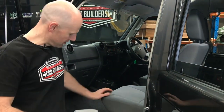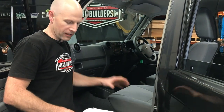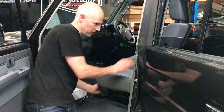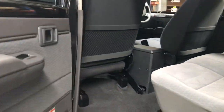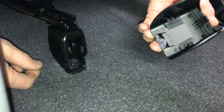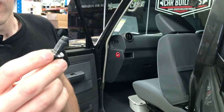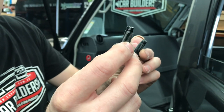First thing we're going to do is remove our seats — 14mm socket. Good thing to do: get yourself a bucket. Anything you take off, put in there so you're not going to lose parts. There are two bolts at the front and two bolts at the back. The ones at the back have a plastic cover on them — this is where Toyota went late model, covered it up to make it pretty, didn't worry about the front ones. Just flex these to the side and they'll unclip, then that'll expose another 14mm bolt. Note that these bolts are a fine thread — all your seat bolts are always going to be a fine thread, separate to other bolts used in the truck.